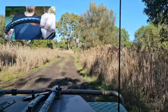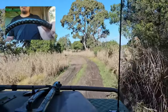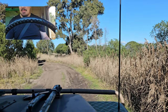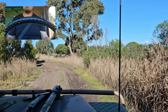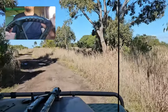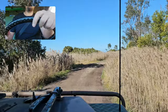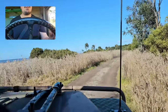This bit gets a bit rough around this corner — right here is okay. What we might do to avoid losing momentum is stop, put her in neutral, engage six-wheel drive, low range, then take off. I expect to experience wheel slip here — that also locks the centre differential. There's a video I've done on how the centre differential works in these; if I remember, I'll put a link below.